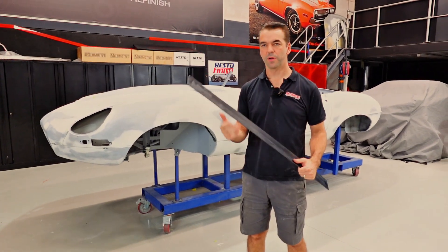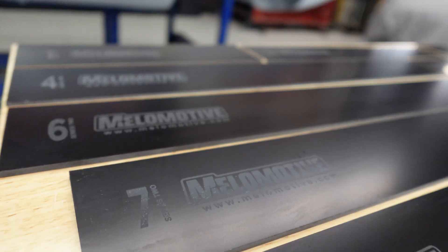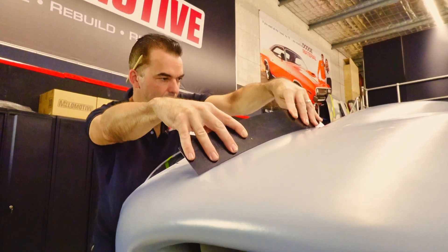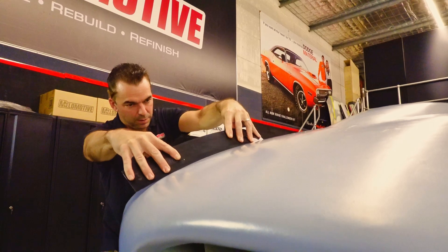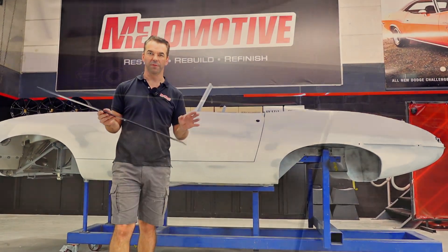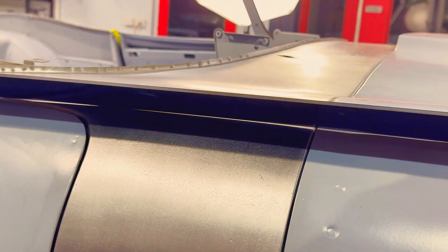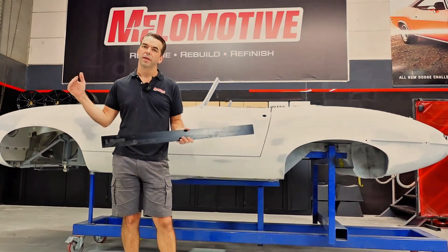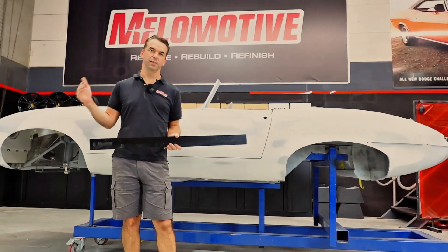We have made our splines out of a composite material resistant to solvents, abrasives, and all the chemicals that correspond with refinished products — same tool, different material for this refinishing application. Our definition of spline is effectively a thin piece of material used to smooth a surface of fixed points. A spline is not an arc, a sweep, or a radius; it's not some form of gauge, not a sweep used for coach building, not a mathematical ellipse that can be calculated. A spline can taper, flex, twist, and accelerate, but in its essence it makes a smooth transitioning curve off some given hard points.